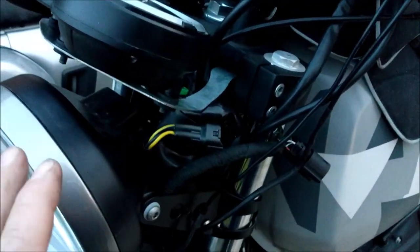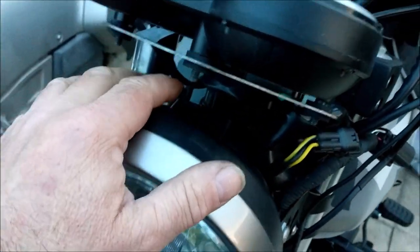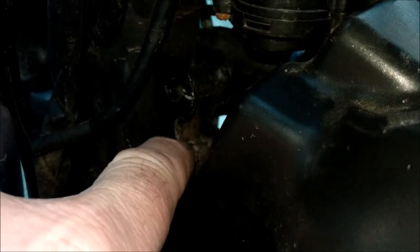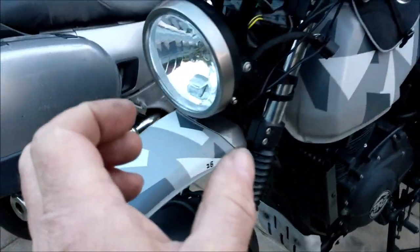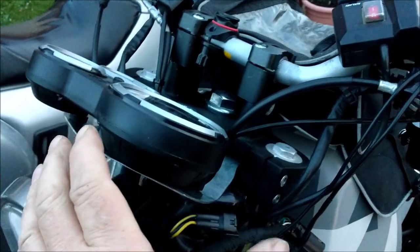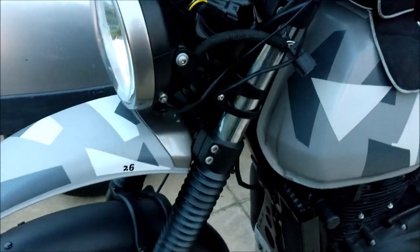Okay, I've got the wiring to sort out. Basically the wiring's got to be dressed very carefully behind here, because there's the notch. Let's put some light on the subject. You've got the notch bracket there, which held the front bracket. That's obviously rigid and fixed, and there's quite a few sharp edges on it, so I don't want anything snagging that as these handlebars and the yokes are turning around. So, yeah, those brackets look okay.